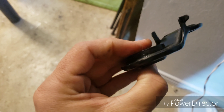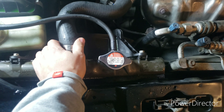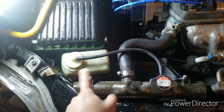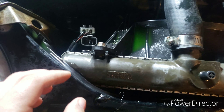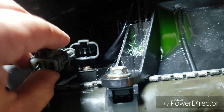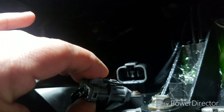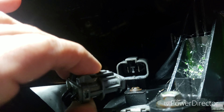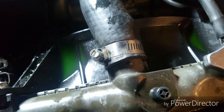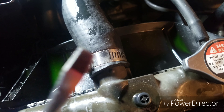Pretty simple, not so hard, but takes patience. We're going to start by removing this mount - this holds the radiator in place to the chassis. It's just a 10 millimeter. Once that's out of the way you can move this and it just slides right out. There's a little bushing right there that holds it in place.